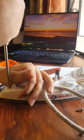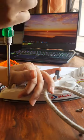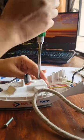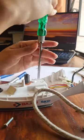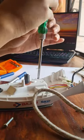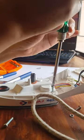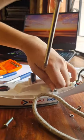The working of an electric iron is very simple. It takes current from mains and heats up a coil inside it. The heat is then transferred to the base plate which is pressed against clothes to remove creases. The thermostat is generally used as a bimetallic strip. As the name implies, a bimetallic strip consists of two different types of metals with different coefficients of expansion that are bonded together. This means that in the presence of heat, they expand differently. This bimetallic strip is connected to a contact spring by small pins.